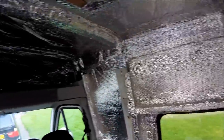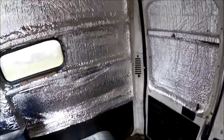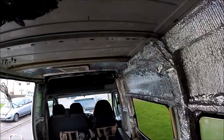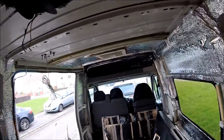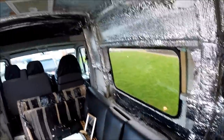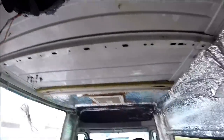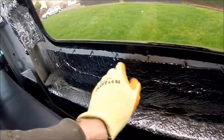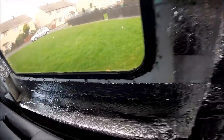They've started on the insulation on the inside but it's just bubble foil all around — it's just a mess. I'm trying to convince my brother not to bother with this van. It did come with a few bits, so I've said to him just try and keep the parts and get a better-bodied van, because the amount of time you could spend trying to rectify other people's bodge jobs, you could just be spending on the actual conversion itself. All these windows would need to come out, all the skylights and the aircon would need to come off, all these holes would need to be filled in or covered, and proper bonded windows would have to be fitted. Look at the state of it — screws going through the panel all the way around the window. This is the perfect how-not-to video.